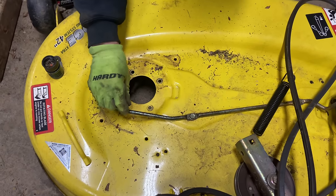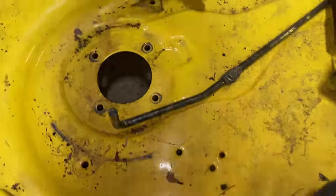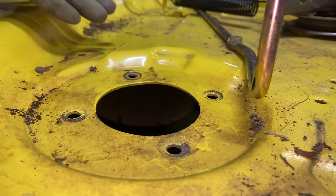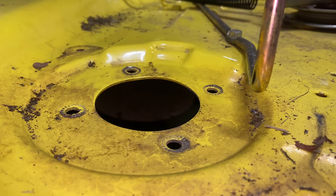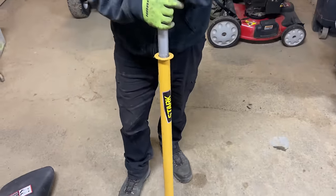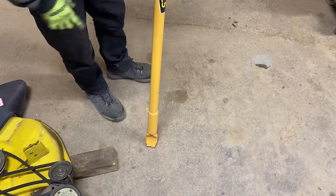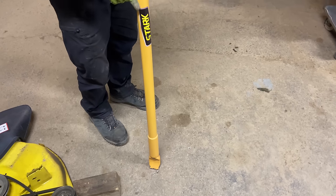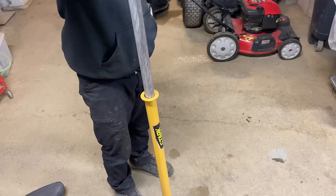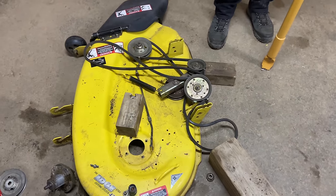Now we can see how it's raised right here because the mower deck just got bent up from where the blade hit. So we are going to smack it down pretty good right here. We use a tool that I've had forever. For years and years I use this tool to break beads off of tires when I do a tire change — I call it a slap hammer. I don't exactly know the name for this thing, but I'm pretty sure I bought this off Amazon and I will put a link in the description below. Basically all this is, is a very heavy slap hammer. It's great for taking beads off your tires, but also this is how we do what I call the dealer adjustment on the mower deck.